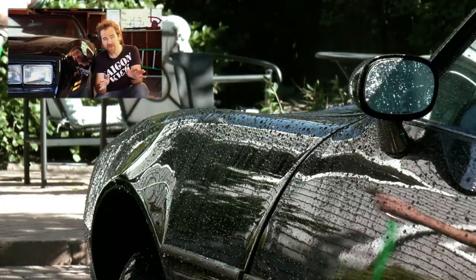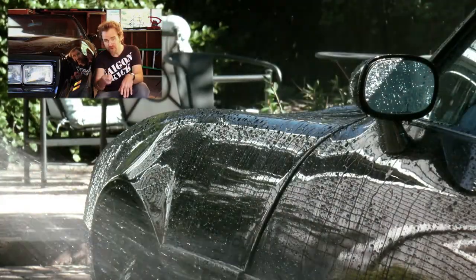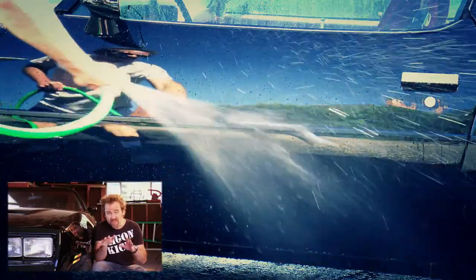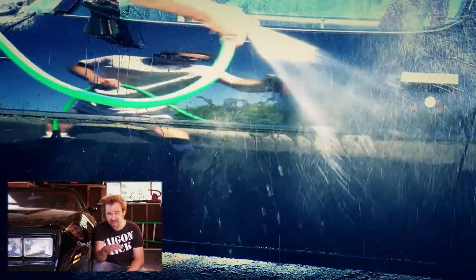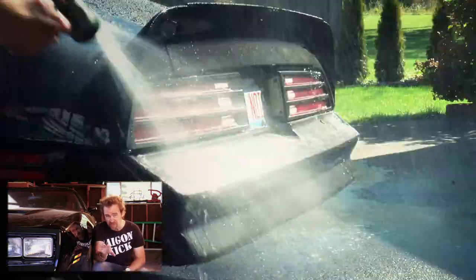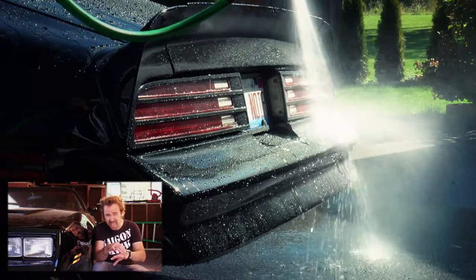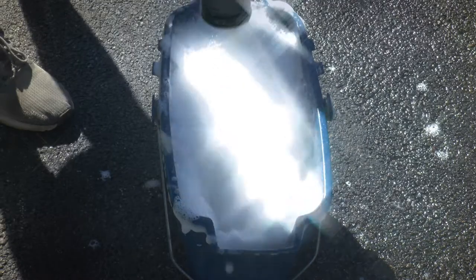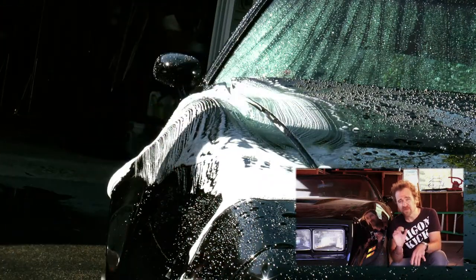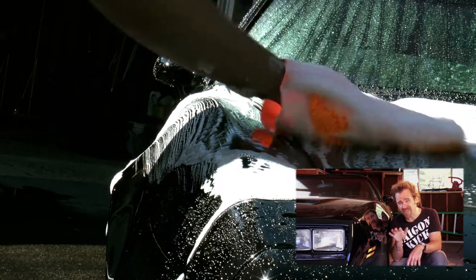Do you own a California duster? Throw it out. All you're doing is trapping contaminants and rubbing it directly into your paint. Always keep two sets of microfiber towels and mitts separate from one another in both their clean bin and their dirty bin to minimize any cross-contamination between both sets. I would also wash them separately in your washing machine as well. Suds are your friend. Got a foamer? Use it. When you're washing the car, when you're drying the car, there is no reason to put any undue pressure directly onto the paint of a car.